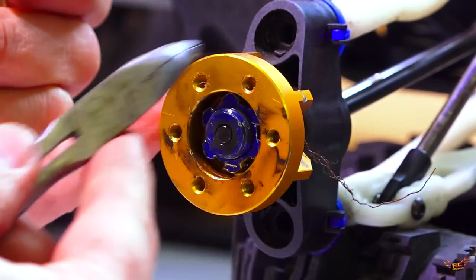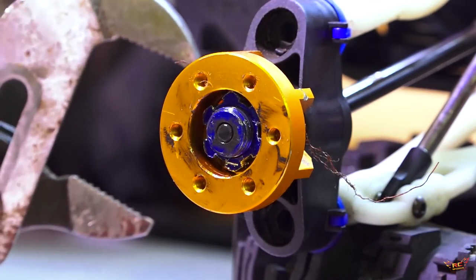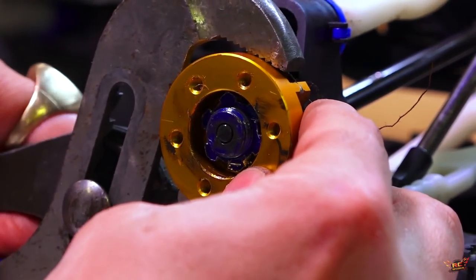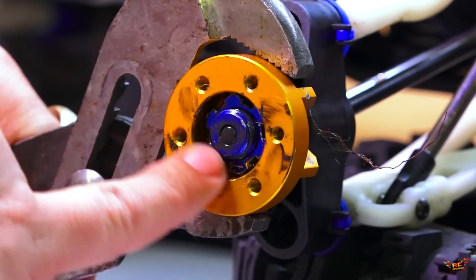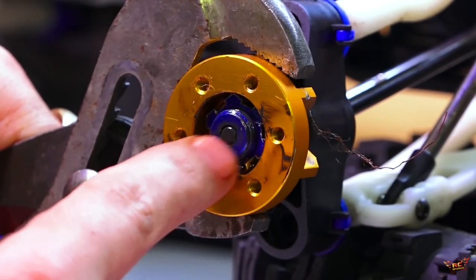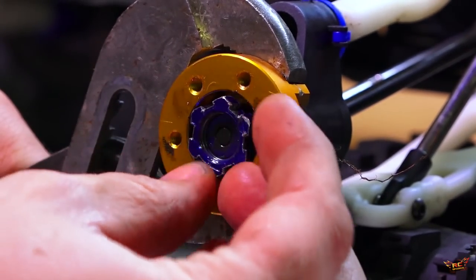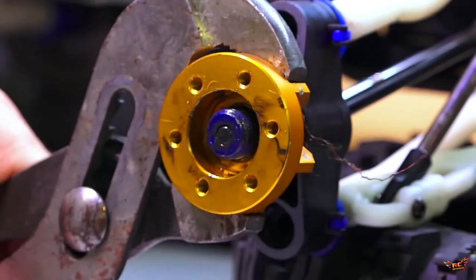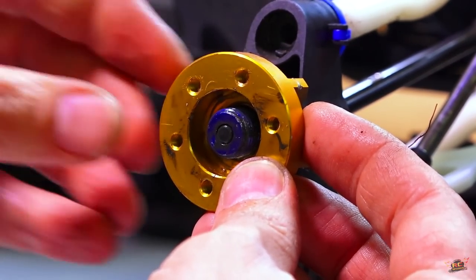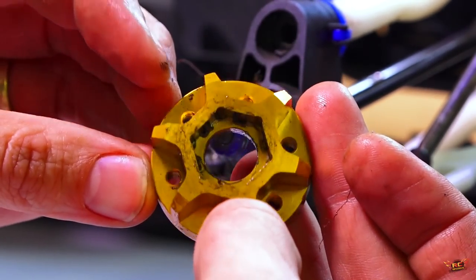All right, so the back mounting hub for that rim is quite strong and sturdy, made of aluminum. I'm gonna take some channel locks on a wide setting and just grab it so it doesn't move around. This inside washer there, it's a star pattern. It's kind of funny. Can't get in there with a socket or anything. So I'm actually gonna be using some curved needle nose pliers. I'm just gonna start undoing that washer. It's backed up far enough, I can just use my fingers. And then release, and just slide it off. Piece of cake.